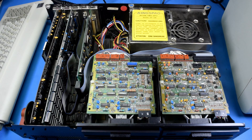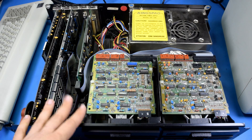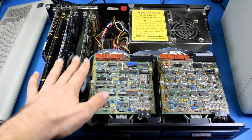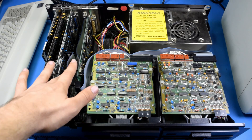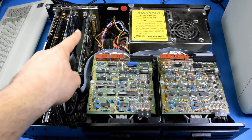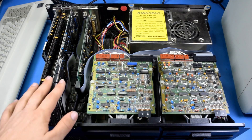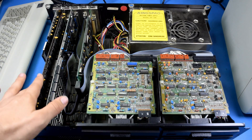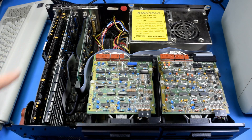I want to start out by showing you what I have in my 5150, and give a little background on how you set one of these up. Starting with the ISA slots: I currently have the floppy controller card in the first slot. The second slot is unutilized, but the back plane is taken up by the parallel port for the Tecmar Captain, which is in the next slot. The next slot has the color graphics adapter card, and the final slot has my Monotech XT to IDE adapter.